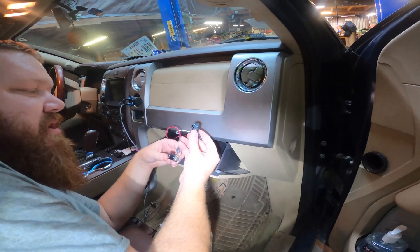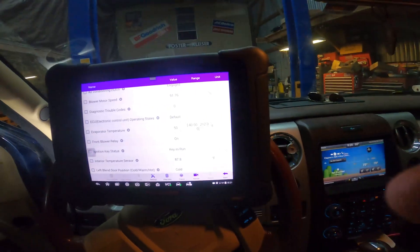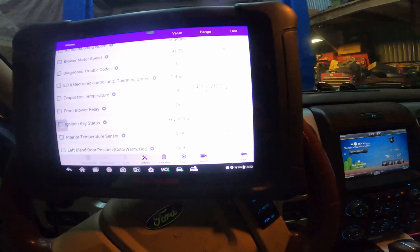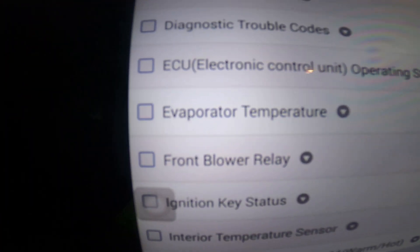I'm going to start this in the off position because after we connect the scanner up and start the truck, we're going to get into the scanner to see what temperature the evap is reading, and then we're going to click the switch on to confirm that the resistance is changing that value. So if you don't have a scanner or a friend with a scanner, you can do this — it's just going to take a lot more trial and error. I have this nice nifty scanner and I'm in the HVAC module. We'll come down and see this evaporator temperature. So it wants to, in the programming state, keep the evaporator at about 50 degrees. The reason we're doing this is because that equates to about 58 to 60 degrees Fahrenheit coming out of the vents, which just isn't cold enough for AC, especially when you get temperatures up in the mid hundreds. So we want to bump this up by about 15 degrees — I want this to jump all the way up to 65 degrees, give or take based off the adjustment.